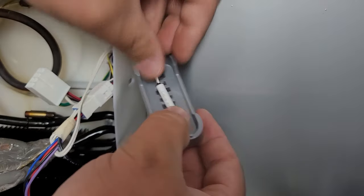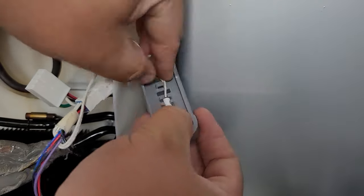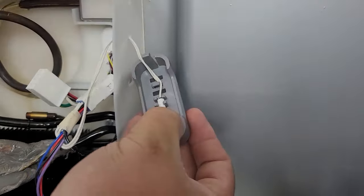The thermistor on the black line is far more likely to be the problem, but for this particular KitchenAid, both sensors and fan come together as a kit so you have to replace all three at the same time. To reinstall the fan, thread the black pegs onto each of the four slots, then use needle nose pliers to pull on the pegs to fully seat them onto the plastic housing. This can be tricky by hand but the pliers work great. In many instances your kit will also have some sticky tape for the front of the fan to insulate it against the plastic housing when it gets reinstalled.